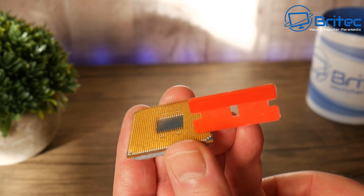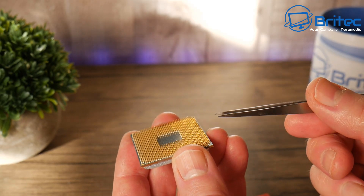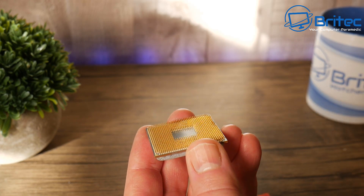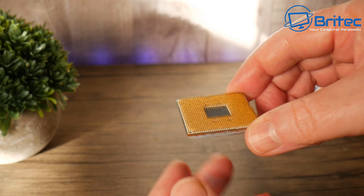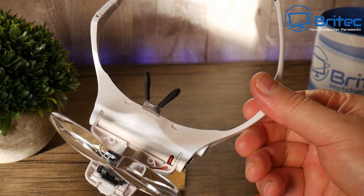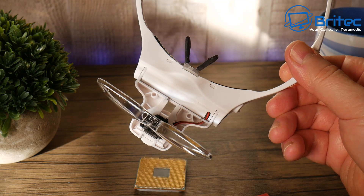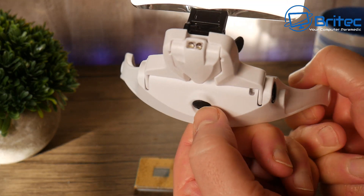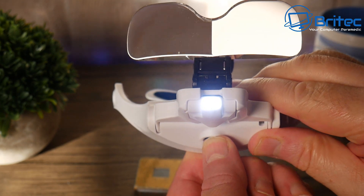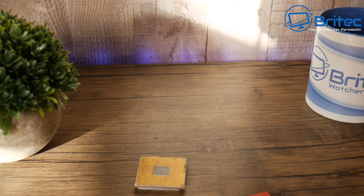It's pretty straightforward and easy to do, but you've just got to take your time and not rush it. It can take either 10 minutes or an hour or longer. I also use tweezers — really thin tweezers — to grab the pin and just slightly bend it. You want to grab it at the bottom if possible, not at the top, and just take your time. Another essential bit of kit is these magnifying glasses with a super-magnified lens and a built-in light.